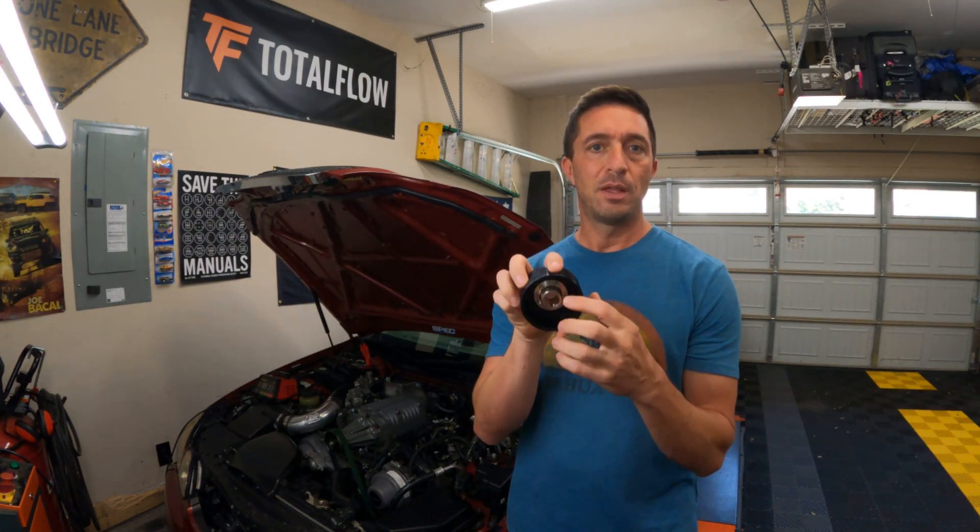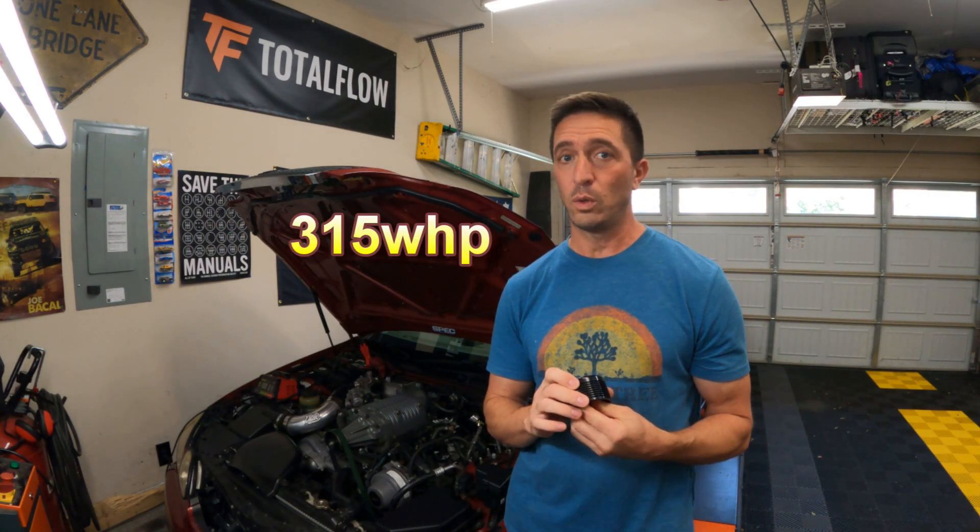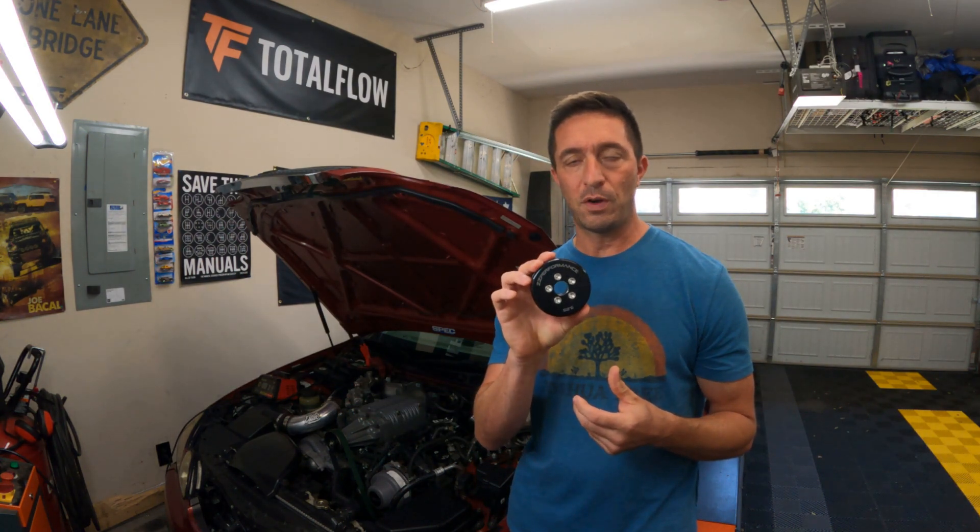What I'm going to have to do is press off that pulley and press on the modular adapter, then install the pulley itself onto the modular adapter. My power is somewhere around 315 wheel horsepower — keep in mind the GS400 is 235 wheel horsepower stock, so that's almost 80 wheel horsepower better than stock. I'm hoping this 3.25 pulley takes me into the 330 wheel horsepower range, but you don't really know until you put it on the dyno. Local dyno places are charging over $300 US to run on the rollers. This thing is going to need an LSD and a clutch much more than it already does with this pulley installed.